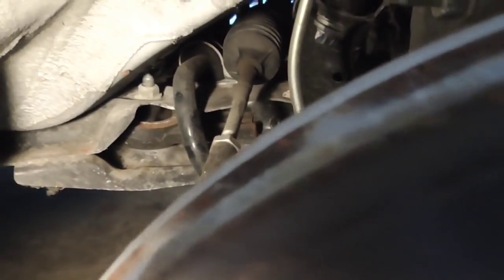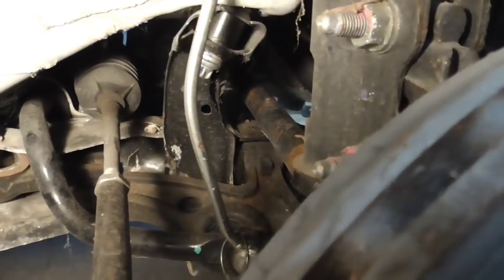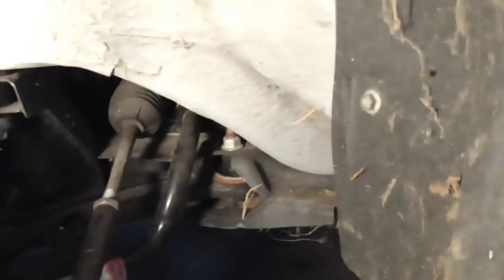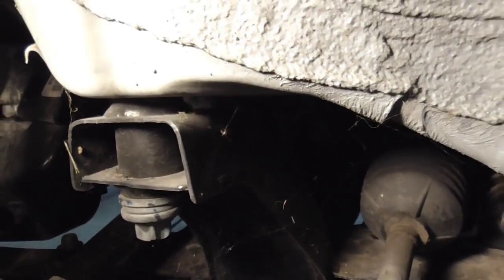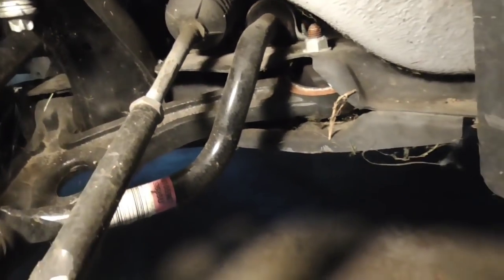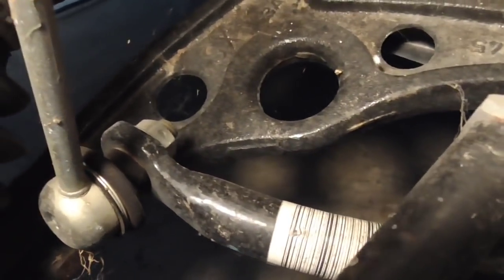So actually, it's probably a little bit more extensive than that. The subframe is also messed up partially, and that's a welded piece — welded to the whole thing. Let's go to the left side here to confirm. Yeah, I can see right here — that red piece on this side is straight and level, quite a bit different from the damaged side. And of course the control arm on this side is all in one piece.